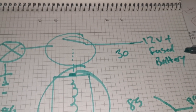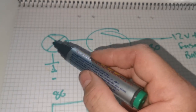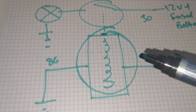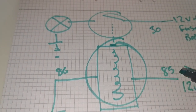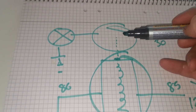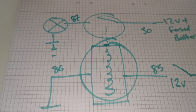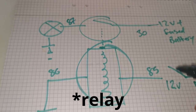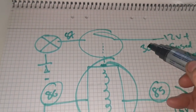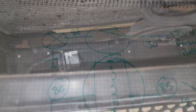So the 12-volt feed comes directly from the battery into our contact 30. The power comes in here and stops — it won't flow to the light bulb because the circuit is open. As soon as we put power through the coil, it turns magnetic, pulls the metal piece, closes the circuit, and electricity can flow all the way through and out to the bulb. That output is our contact 87. So to summarize: 85 and 86 are one circuit for the trigger, 30 is always-on 12-volt in, and 87 is the output to the light.